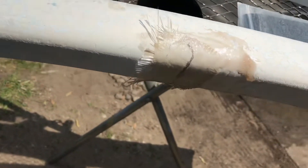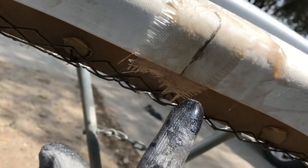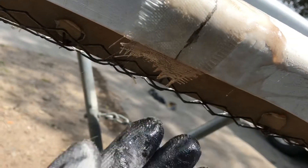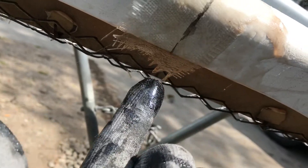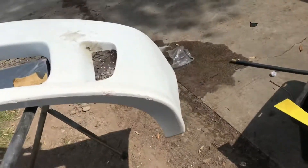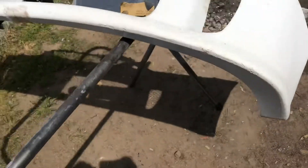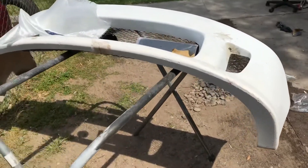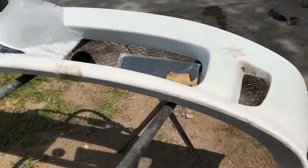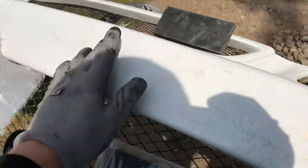God, I really want to itch my nose. I'm covered in fiberglass and I do not want to sniff this stuff. I'm not wearing a mask, which I should be. Any more cracks? This is going to get sanded down. So I'm going to mix some more and lay that down real quick. That plastered layer — whatever you want to call it — goes all the way down to the rim of the bumper. This is just going to get cut once it's hardened, and that's going to get filled in with the filler. So I'm going to let all this harden right now in the sun, let it do its job, then come back to it, sand it, do what I need to do. This has really heavy pock marks on it, so I'm going to get all that done and then get it ready for paint.